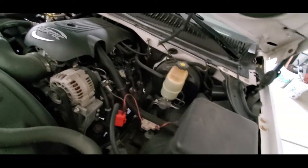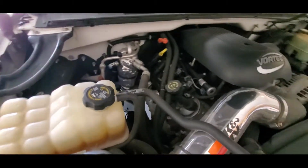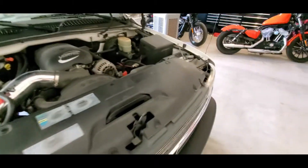It's really, really super clean - that's really all I could say about it. Just a good running all-around little truck. In the near future she's going to get a cam, heads, and some headers. I'm thinking I'll stick with the stock 5.3 heads and just put some 6-liter valves machined into the stock 5.3 heads so it can retain compression and maybe give me a couple more horsepower. I don't think I'm going to be pro-charging or turbocharging - just going to drive this truck as a naturally aspirated little thumper.